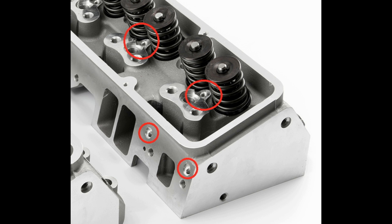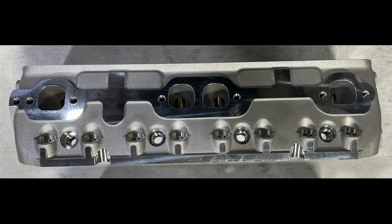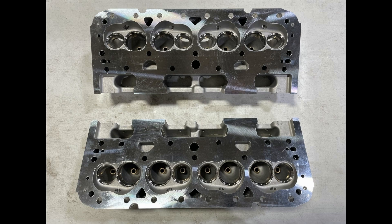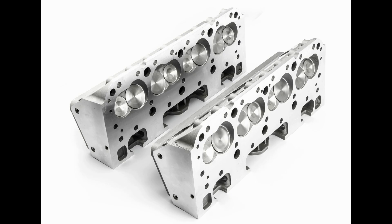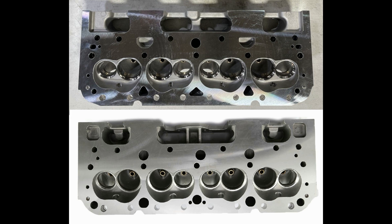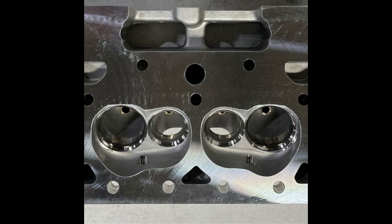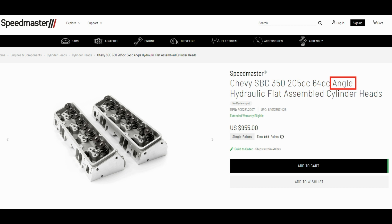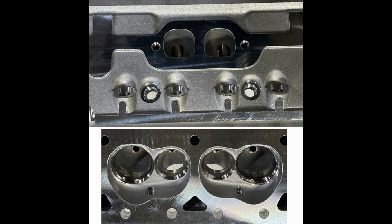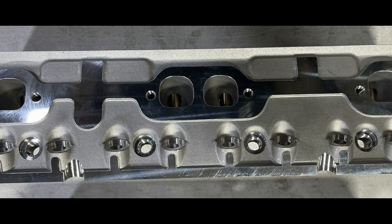Even the iron heads I made a video about had them. Moving on to the third ad picture, we get a good look at the exhaust flange — nothing like the typical Speedmaster heads I've seen. The last ad picture shows the deck and chambers. I had to go to Summit's website to find a decent Speedmaster deck picture. It's for a different part number, but same thing, as all their heads pretty much look alike. I do want to note the plug position is different — the eBay mystery set is a bit more toward the intake valve. Technically the Speedmaster part number says these heads are angle plug, but the eBay mystery heads, you can see in the pictures, they aren't. The chambers are kind of deceiving, but the exhaust flange shows they aren't — they're straight plug.